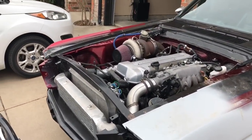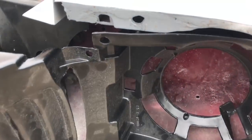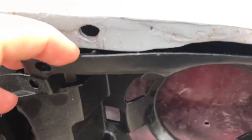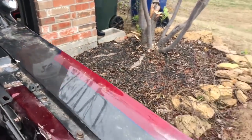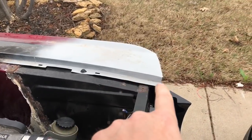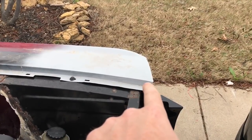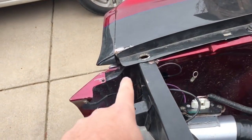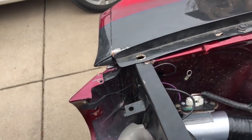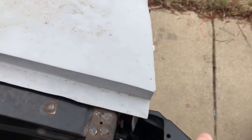We were just discussing a couple of tweaks. I don't know if you guys remember this fender or not, but it's not lining up right here. Matt was trying to get this fit on — there's a little stud right there that's supposed to locate in that hole and it's not fitting, it's up too high. I did a lot of work to this fender with it off the car, including a patch in this front section up here. That line is kind of straight and it's a square section there, but if you look on this side it actually tapers down pretty sharply. So we're going to have to cut this back open and lower that down and re-weld it.